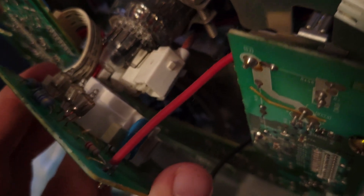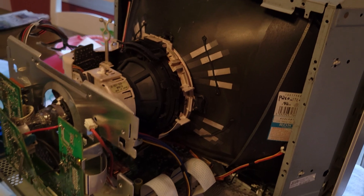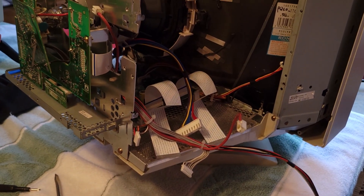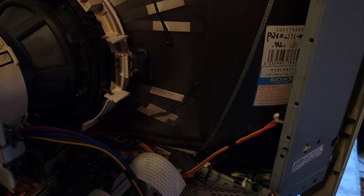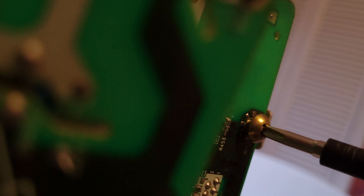And then we've got this to work with. I removed the neck board from the actual tube socket. There's also that little plastic thing that has the focus wires — you want to remove that too to get the tube out. I'm gonna move the deflection board with the flyback out of the way. Look at these convergence strips — look how much they put on here. The convergence isn't even that good on this tube and I've worked my ass off to make it good. This tube must've been a pain in the ass at the factory.